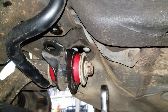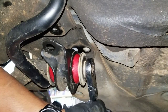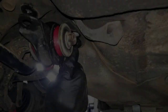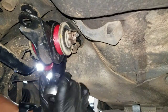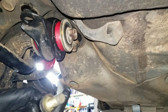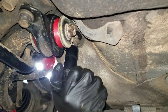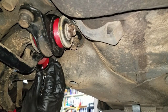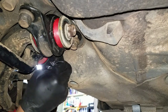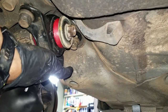I'm going to tie it down just so it doesn't move. It's not moving, but under the weight of the vehicle it might want to wiggle a little, so I'm going to snug it a little more. Now it looks like we can attach it back to the car. It's taking a bit of wiggling and convincing, but it all goes back together relatively smoothly. Now for the sway bar bracket — I actually had trouble getting the bolt in, but I knew once I attached the lower control arm it would lift everything up and make it easier to align, so I left one bolt out until I did that.